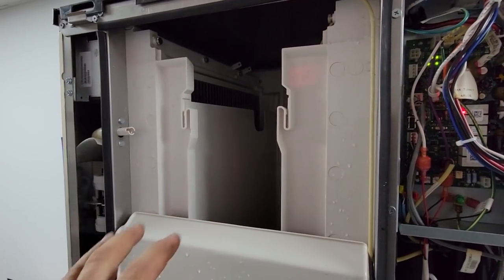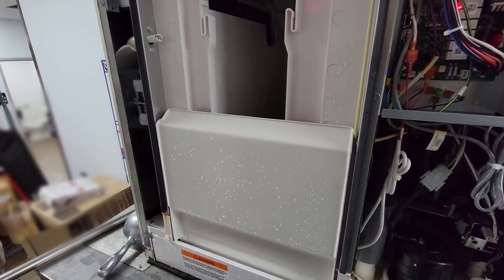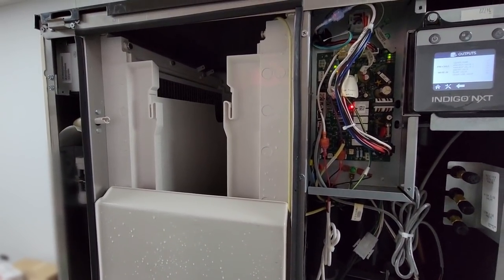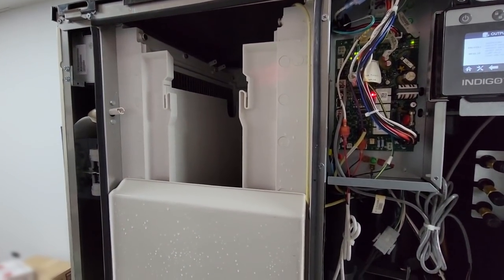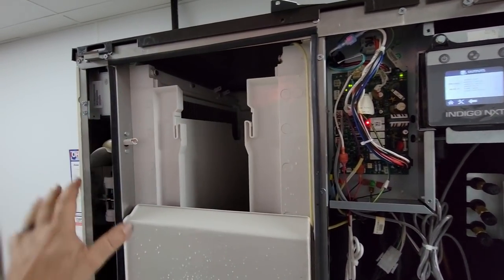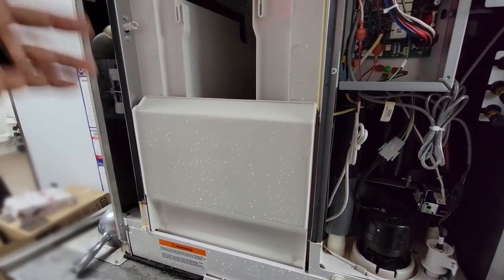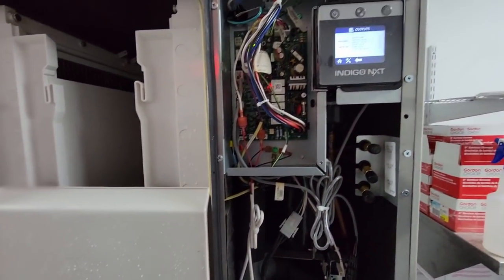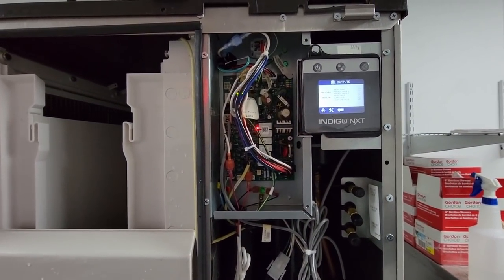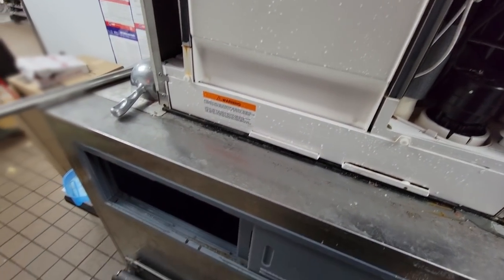As always, if you leave the cover off and it's warm in here, it will slush the ice trough where the water's at, which will then cause the whole machine to take a dump on you — literally. So make sure you cover it back up when you're testing it, whether it be a piece of cardboard or whatever. It'll save you some headache, because once it slushes you might as well just start all over. Let's see what we got here — hopefully we can make a nice batch and dump and get the heck out of here.